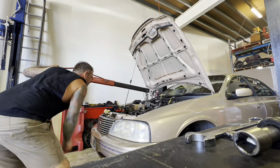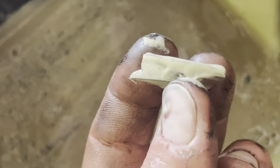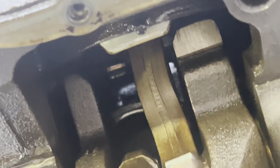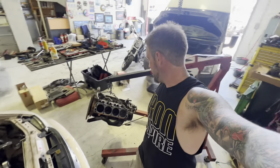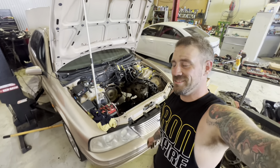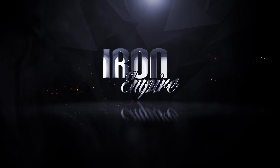Okay, you'll now see we've found our culprit. Take a look over the other side here. This is a piston coming up to top dead centre — it's around about zero deck height. Now looking at number eight at the back of the block here, this piston is down around three or four mil. We've got ourselves a bent rod.